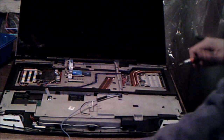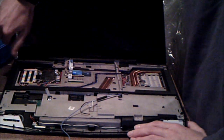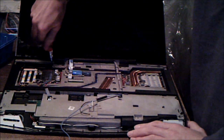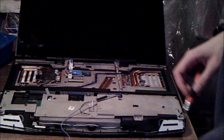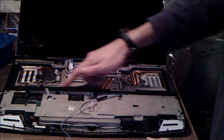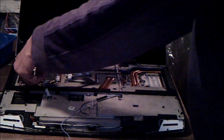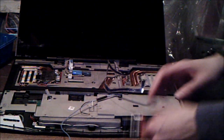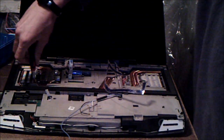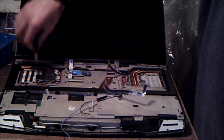There's one brace out, and there's another brace coming out. Before you take out the video cards, there's a crossfire cable — because these are ATI video cards. This one is your master, that's your slave. From the master video card, gently peel it up and unhook it from the crossfire port, then very gently peel it back — it's held down with sticky tape. To take out the video card itself, there's one screw here and another screw, and that'll free your video card.